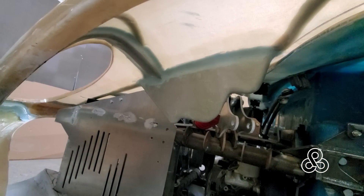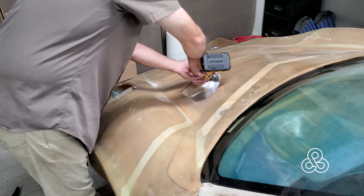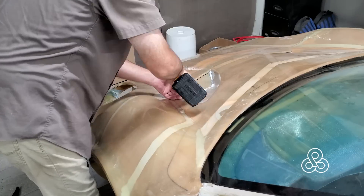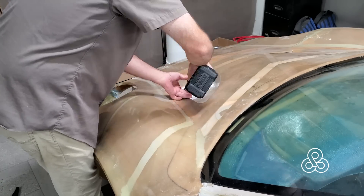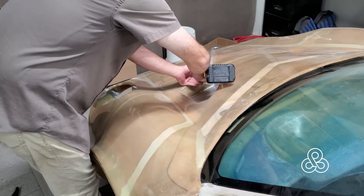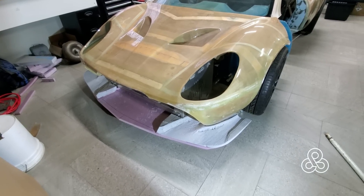Here's the little baffle - you can see the little notch: one for the shock absorber and one for the upper A-arm, which will divert the air down low. With most of the underside work done and the mounting points and latch mechanism ready to go, the only remaining work on this bonnet is finish work to get it ready for primer and paint. One of the first steps toward that is cutting out the little nose holes - and there they are, ready to go. As a bonus, I've taken a step forward roughing out the splitter, and I'll put a link here to the previous video showing more on the hinge mounting and latch mechanism.